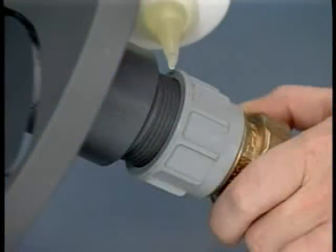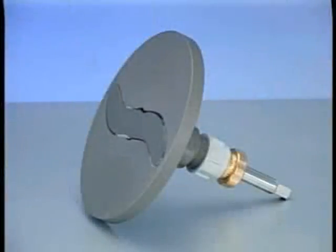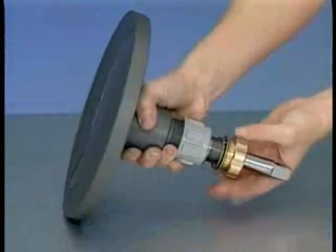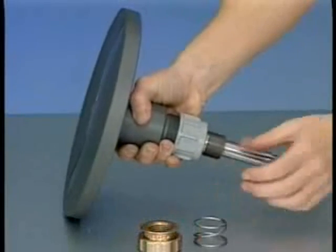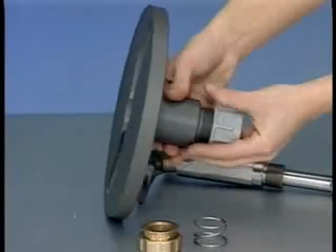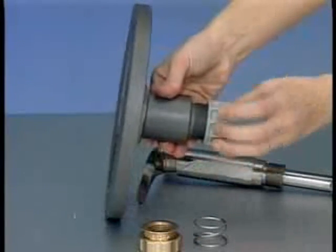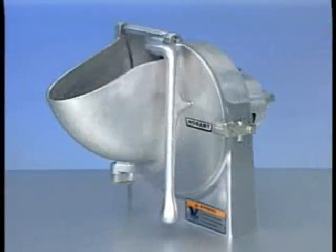Use a drop of tasteless oil on the adjustment threads after cleaning. Occasionally, disassemble the slicer unit for a thorough cleaning. To do this, it is necessary to unscrew the knurling thrust collar, which has a left-hand thread. The spring is then free for removal. Draw the knife and shaft assembly. Unscrew the adjusting nut from the plate. Note: after cleaning, to prevent damage, the thrust bearing must be tightened until it is seated against the shoulder on the shaft.